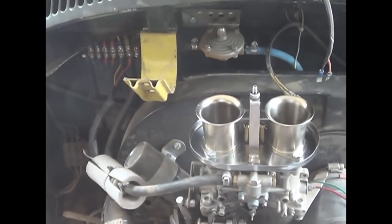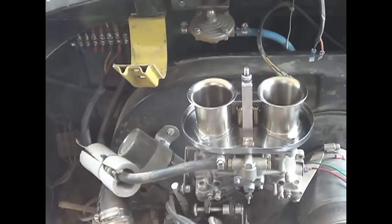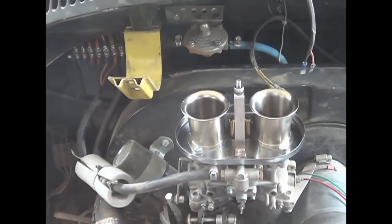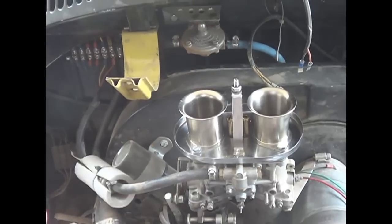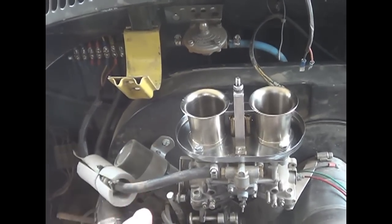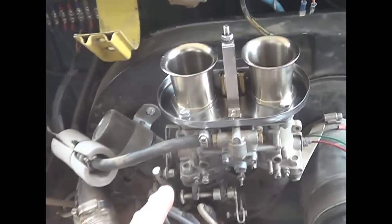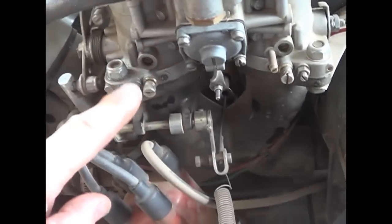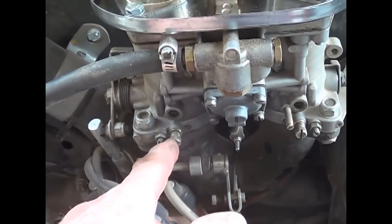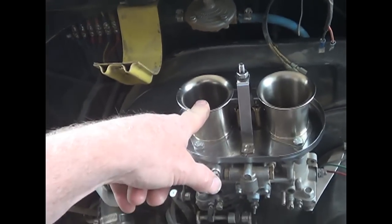Okay, this is a smaller engine. It has an Engle 100 cam. I have about 115 pounds compression on all four cylinders, just as an average. It's all over the place, but let's just say 115. I have 28 millimeter Venturis in a 40 Weber IDF carb. I'm running 55 idle jets up here, and my air fuel screws are out three-quarters of a turn. I'm running the 50 accelerator pump squirters, the stock ones.